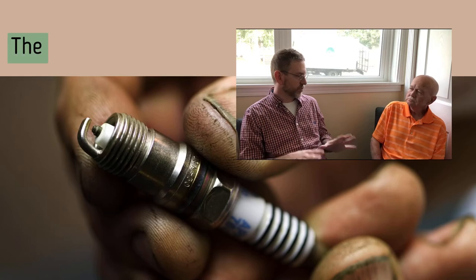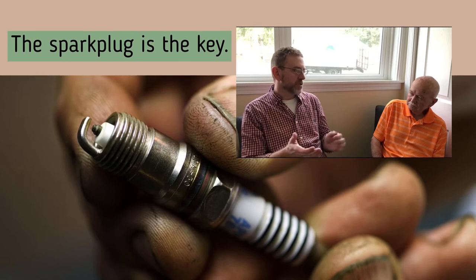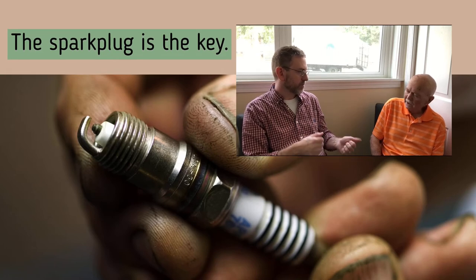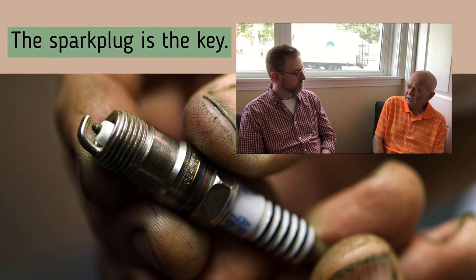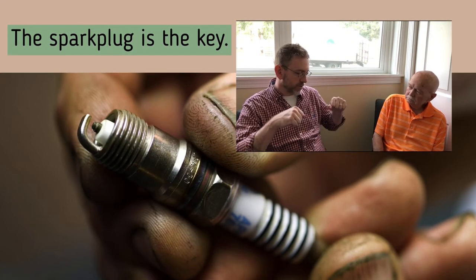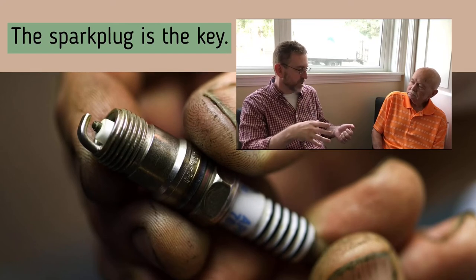A lot of people say you should take the spark plug off before you do that stuff. The idea is so it won't start or kick over — that's always a safe thing to do. So pretty much there are two ways to tip them over. You really shouldn't flip it over, even if it's a push mower. If you're going to tip it, it's either front wheels up or whichever side the spark plug is on. That's a good rule to always have handy. You can get jacks and lifts for riding mowers, but for a push mower you can just push down on the handle, prop it up, or tip it sideways as long as the spark plug is coming up, then prop it up.